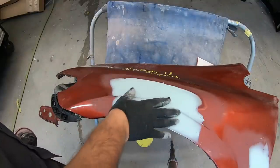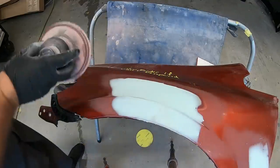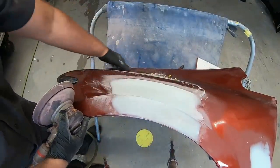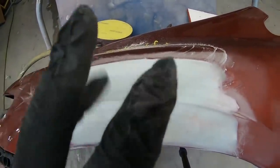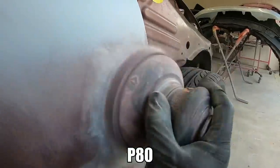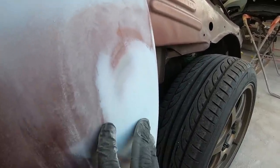Once our filler is dried — I allowed a good 15 to 20 minutes, and you can feel it, it feels really good — I'm going to use 80 grit on the DA just to knock down the ridges. We don't want to use this all the way through; it's just a quick pass. Now we have edges that are nice and smooth and we'll spend less time blocking it out. Let's perform this on our other two dents. You can see how it's starting to feather and transition into the old paint. Let's leave this here and finish it up with a block. And lastly our door dent — this one's good, and all three dents are ready for blocking.